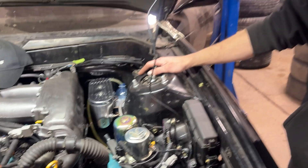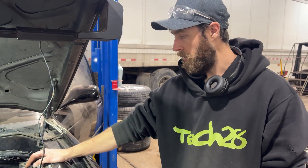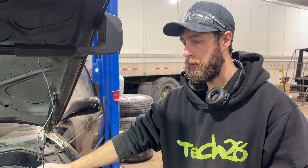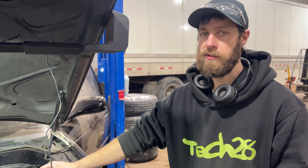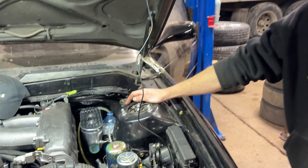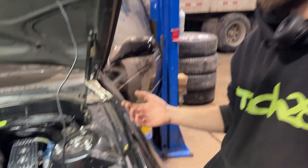It's going to give me good brake performance. It builds between 1,500 to 1,800 PSI under normal braking conditions and can output up to 2,500 PSI, which is pretty crazy. When you buy this thing, it's kind of expensive — I think it's listed on their site for about $1,400 US.